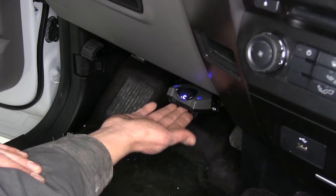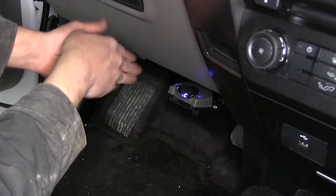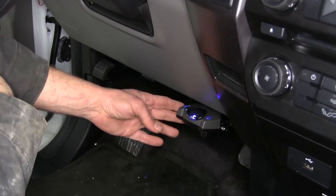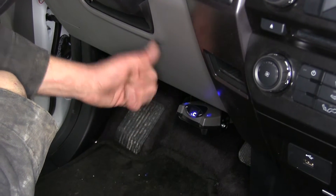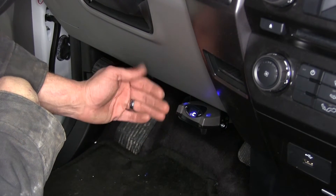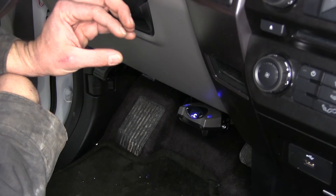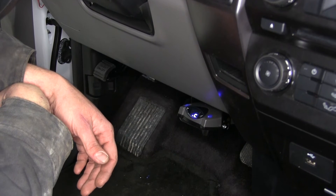The P2 is a proportional brake controller. This means it's going to work in proportion to the deceleration of the vehicle. The accelerometer inside is going to sense when we're trying to slow down, activate, and send power directly to the rear in a very quick and efficient manner. Whereas with a time-delayed controller, that slowly builds up — so we won't have to wait for our braking response.